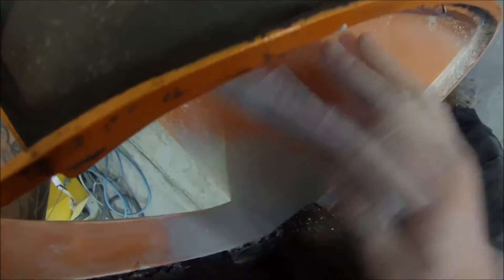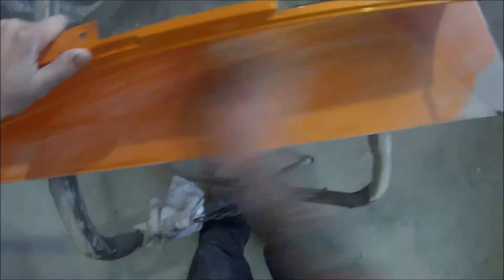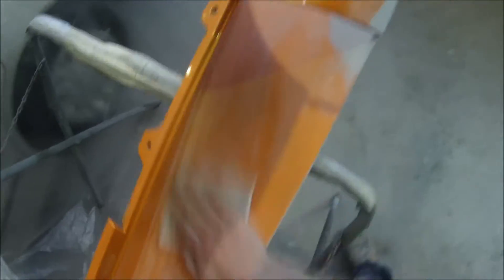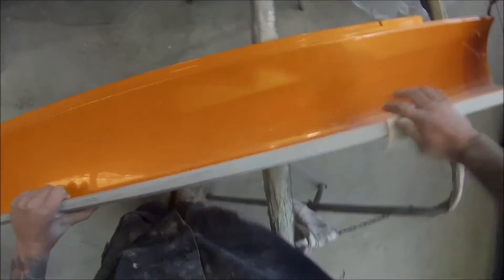Then we've got the sill cover. I left out most of the footage of the sill cover but it still gives you a good idea of the work I've done to it. Inside here there are big runs, which I'm trying to show you here — ended up just having to do that by hand. You could get a little block in there if you wanted, but I was able to just go over it a few times by hand and get rid of it. 500 grit for most of it, then go over it with a bit of grey scotch brite and then 800 grit after that.